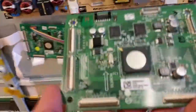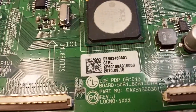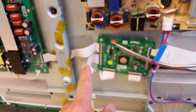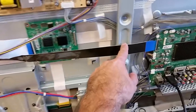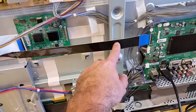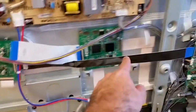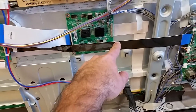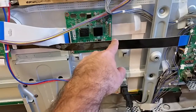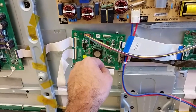The board number you're looking for is EBR63450301. With a little bit of hackery on the cables — this is a 51-pin cable, make sure it's 51 not 50 — you have to do some alignment so it goes on both sides. This cable came from some LCD or another TV; we have hundreds from disassembled TVs and just picked one that was long enough. It's currently hanging here on one screw, and we're going to improve that and add some heat dissipation for that processor.